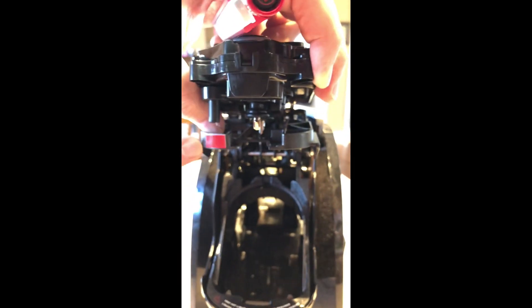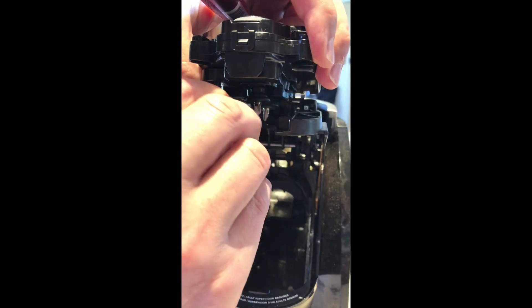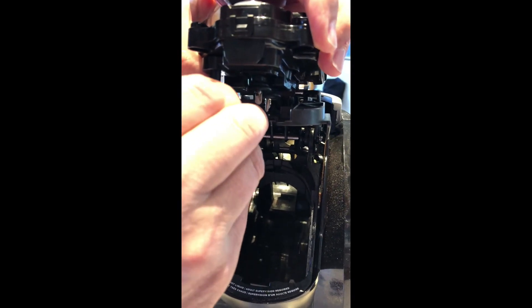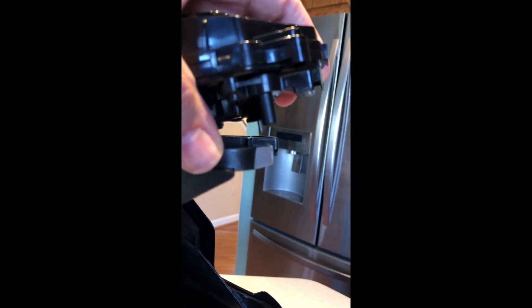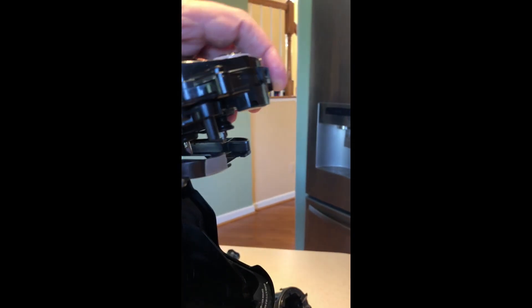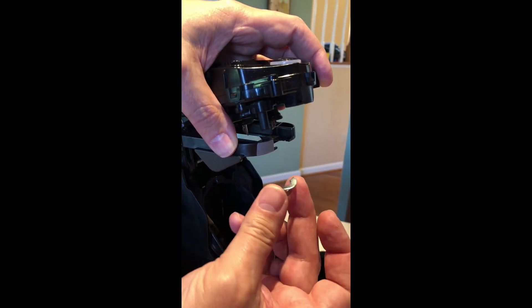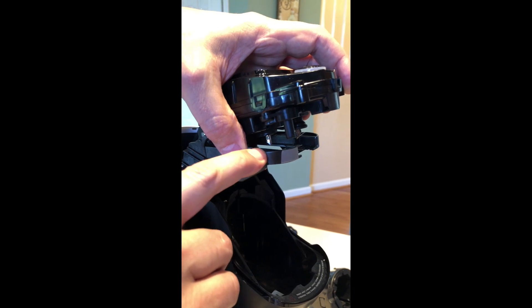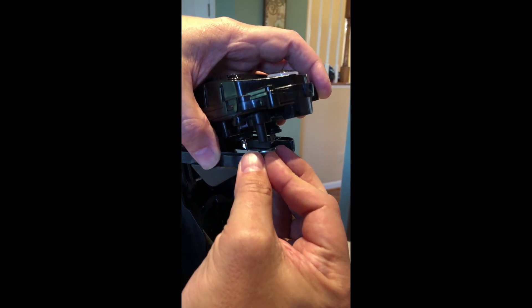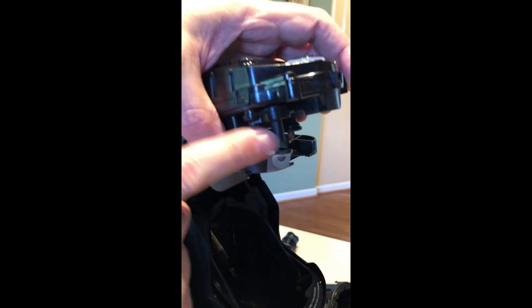Here's one side, here's the other — you can see I put a bumper on there. The hard part is getting the red backing off the other side of the adhesive. Now I'm going to attach the bent washer with the shorter side up, not flush with the top edge but a little bit higher, right below where the pin drops down.